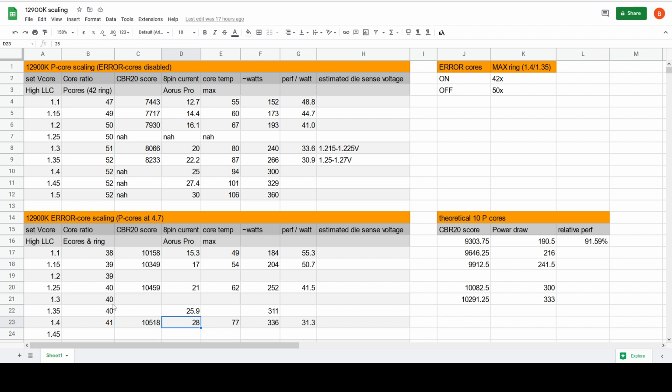So, yeah, that's kind of the E-core scaling there. And also they just scale terribly, right? You need tons of voltage for each 100 megahertz on the E-cores. It's not really that surprising. As far as I'm concerned, they're laptop cores. The name tells you, right? Efficiency cores. In other words, laptop cores, because laptops have batteries and batteries run out, so you need good efficiency for those. And so expecting them to clock high, well, they don't. So yeah, that's kind of that with the E-cores.